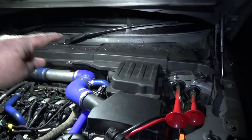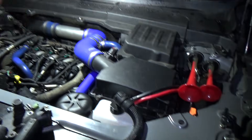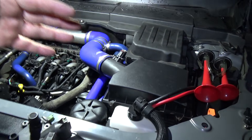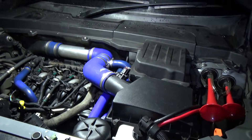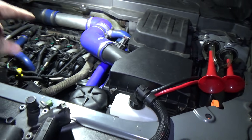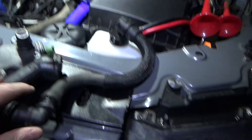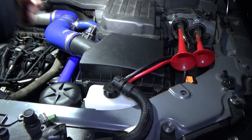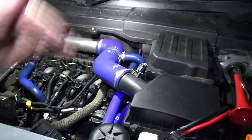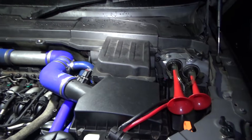This pipe goes off to the heater inside the car — the heater matrix — which is all part of the heating system and the climate control. When the water comes back from the heater, it comes back on another similar hose. Those hoses come through the bulkhead — there are two firewalls: a sort of intermediate one and then the true bulkhead on the front of the cabin.